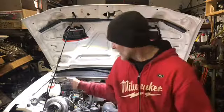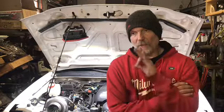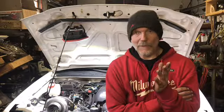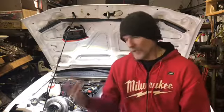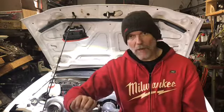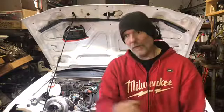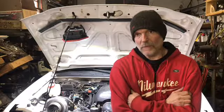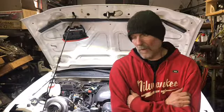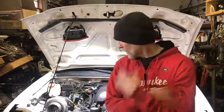When I put the three inch exhaust system on — it's three inch but there are some bends in it and there's a Flowmaster on it — so it's not really a four pound spring, it's opening at like two and a half to three pounds. With the boost controller off, you're getting about two to two and a half pounds of boost. When you put full pressure to the top of the wastegate to push it shut, you get about triple, so it's only making about seven and a half, maybe eight pounds of boost full tilt. We're gonna remedy that today — I'm going to take the top off the wastegate and respring it with a heavier spring.